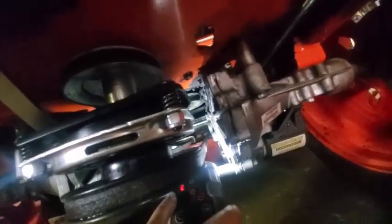Where is the tensioner for, okay, the tension spring for the hydros. I'm looking for that. There's the idler right there, that pulley back in there. And where's the tensioner? Okay, so there's the tension spring back up in there. You can see that. See that spring? So we'll loosen that up and we'll get the tension off of that hydro pulley.